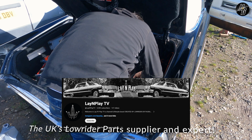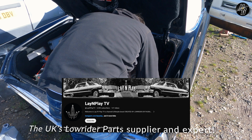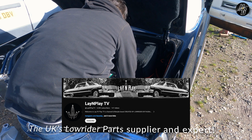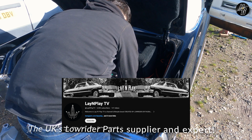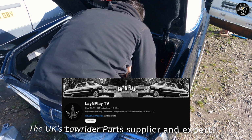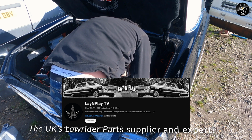And the other one is what's energised via a 24-volt connection. 24, but they say 12 volts on top of these. Yeah, but because of the pressure in the system, it won't operate at 12 volt. They need more power to overcome the pressure in the hydraulic system. They have to be 24 volt. So make sure that your switch live is going to the 24 volt terminal first.